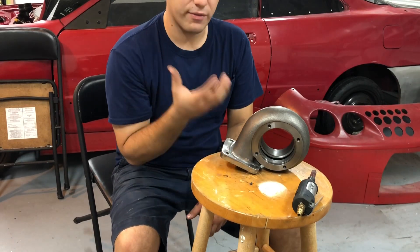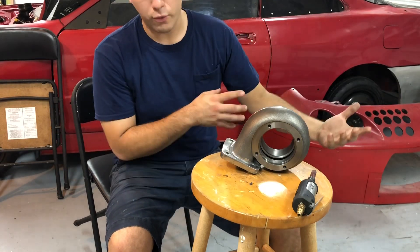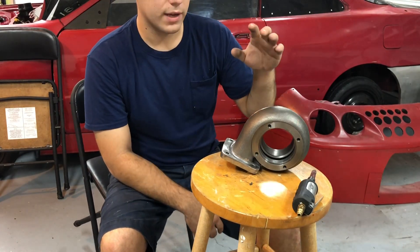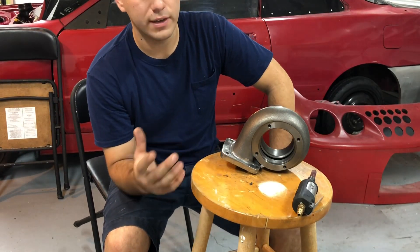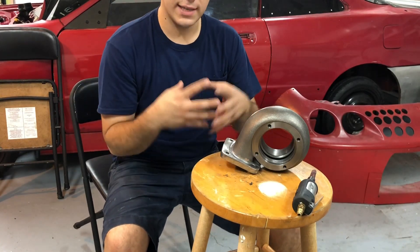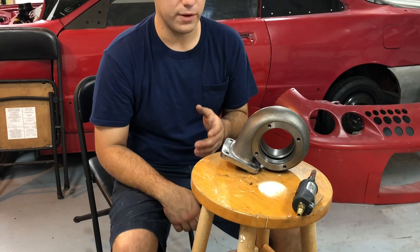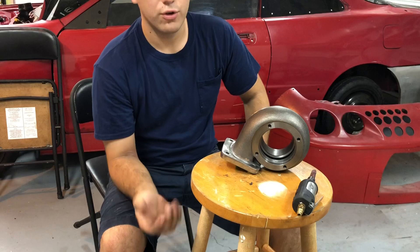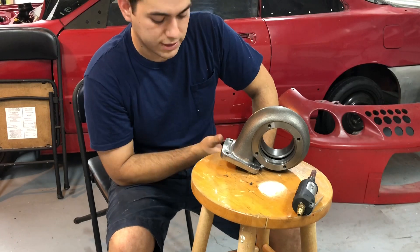As you guys know, turbochargers get very, very hot. What you're doing is spooling the exhaust gas that's coming out of the engine, turning another wheel to bring compressed fresh air back into the motor. So this is a very, very hot component. We want to keep this as cool as possible on the outside, so the under hood temperature is nice and low and we don't have any heat affecting the other components in the engine bay. By keeping the heat inside of the turbocharger, it's actually proven — you create a more efficient turbocharger, giving you a little bit more efficiency to the whole system and making a little bit more power.